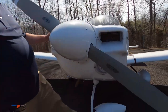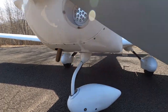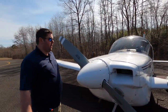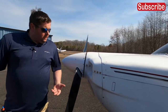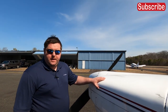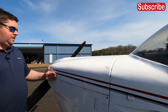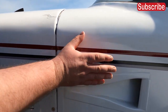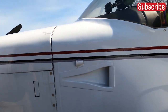The nose wheel is a castoring nose wheel — unlike the Cessna, the pedals don't steer this aircraft on the ground. This aircraft depends on differential braking to steer on the ground, while in the high-speed takeoff regime we use rudders. On the pilot side cowling, you can check the brake reservoir and brake fluid, and look for anything concerning from the power plant. There's also an avionics cooling fan that cools the radios — make sure it's not covered. And there's a ventilation fan to keep you cool on hot days.